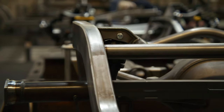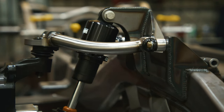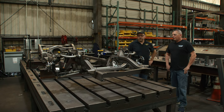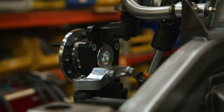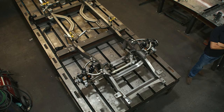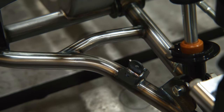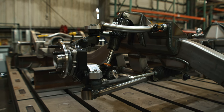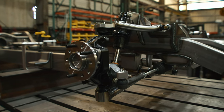So Scott, on this chassis, I understand there's a lot of new features on the front end — things unique to this particular chassis versus the old chassis you've done. Can you explain some of the features that have changed? So what we did is took a new approach. We know that that generation of truck got a lot heavier, and there's a big market for guys that want these things sitting really low with excellent handling. That creates the need for much larger lower control arms, larger bushings, larger ball joints, upper A-arms — same thing.